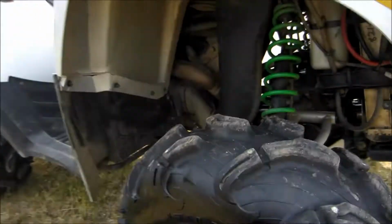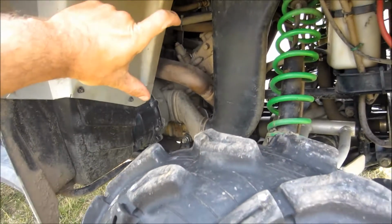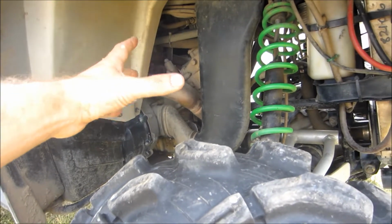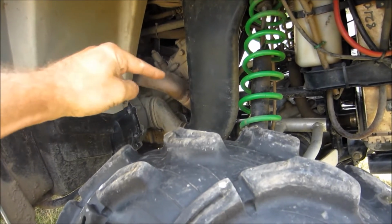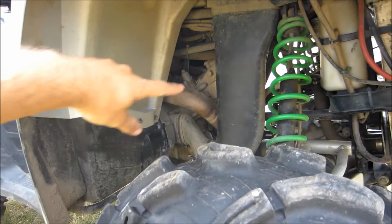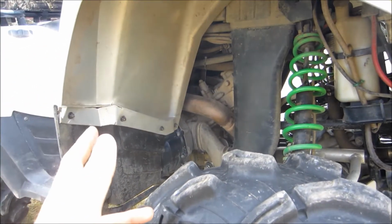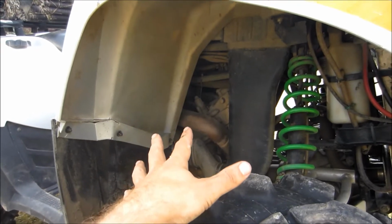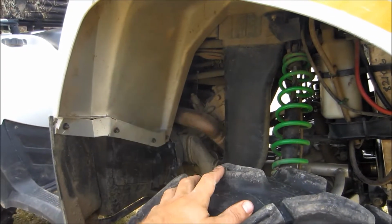Like cars, normally your piston will be like 86 millimeter wide, 86 millimeter stroke, something like that, right? This thing has a gigantic piston and a tiny stroke because they wouldn't be able to fit it in this chassis if it was any taller. I had to take the motor out to do a head gasket on it, and you can see exactly how the whole thing is designed. It's made to fit into tight spaces, but man, it makes awesome V-twin noises.